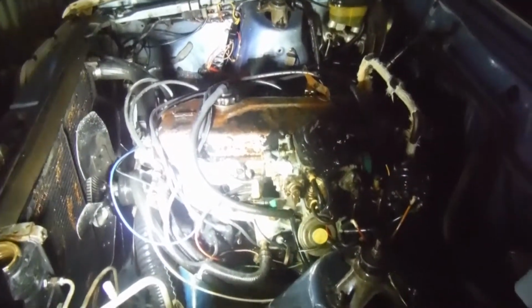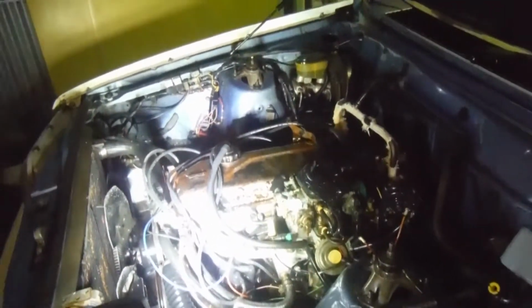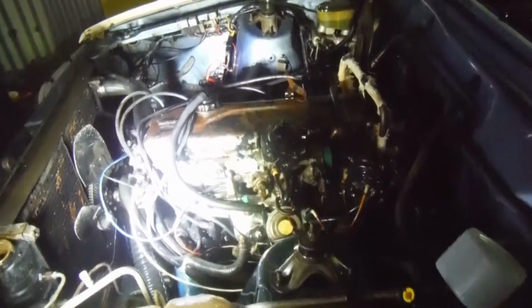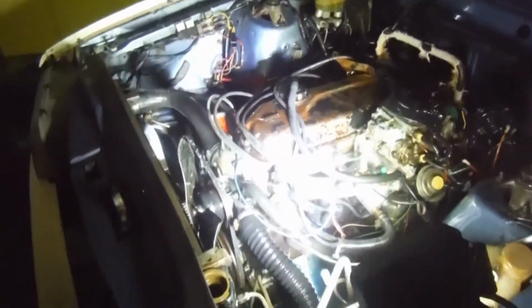In regards to it actually running, the engine will definitely come out and be worked on. And when I had this, I did drive it. Had a few problems with the brakes. The back brakes would creep themselves on and stuff like that. Just basically, I think it sat under a tree for a long time before I got it. And I started fixing it up and spent a bit of time playing with it and getting it running and playing with the timing, because that was really out. When I did pick it up, it was quite often firing and getting a big huff and puff out the carby, but the cartridge made reasonable work of cleaning something that's probably not been cleaned for 15 years up.